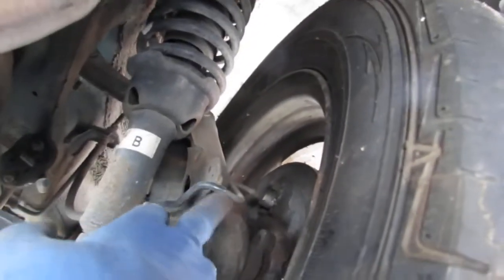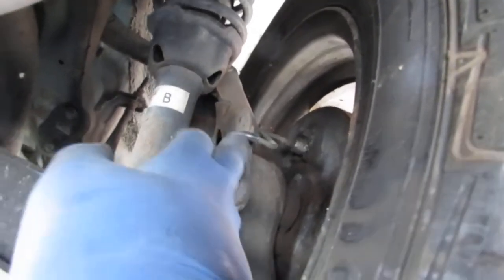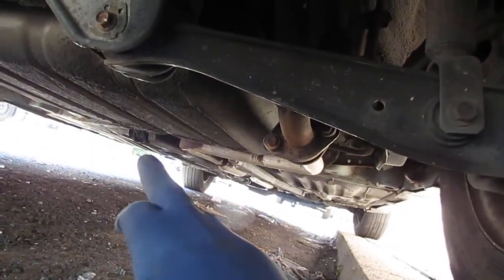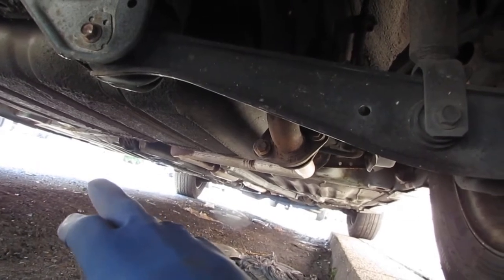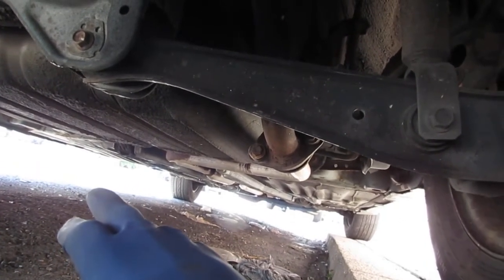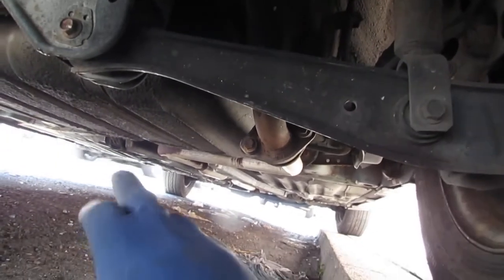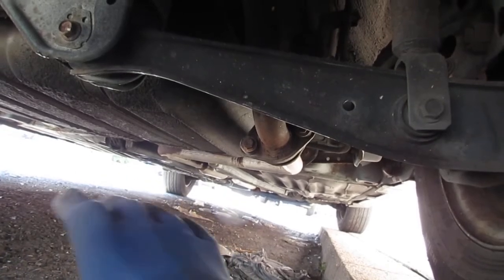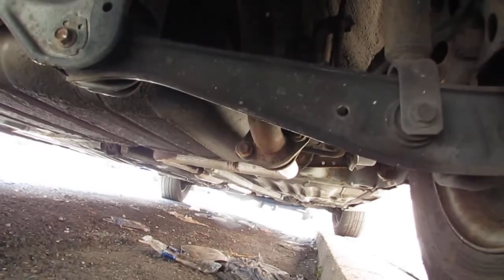So I gotta replace that and the drum. It's gonna be a lot of work. The whole thing's getting replaced, so we'll take you on that little journey. And again, you wanna follow the lines because they can corrode. And when they do, it's not too difficult. You just have to buy a line and reshape it yourself and get a tool to flare the ends of the lines so they fit properly. Okay, so that's that. Let's get started.